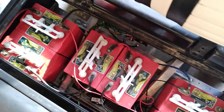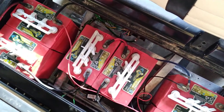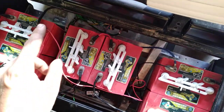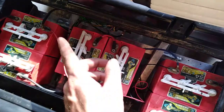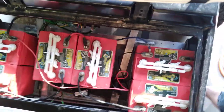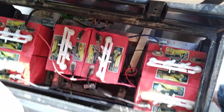It won't fully eliminate the risk — if the batteries get submerged for too long they can definitely short circuit — but eliminating the higher voltage 48 volts by disconnecting the main positive, main negative, and all the main power cables in series will definitely help the situation quite a bit.